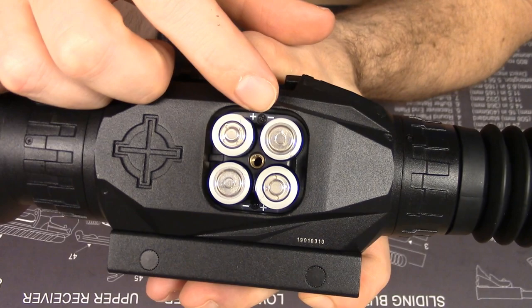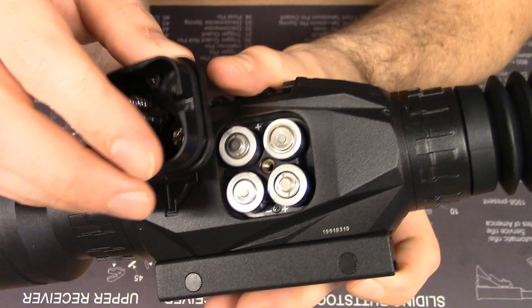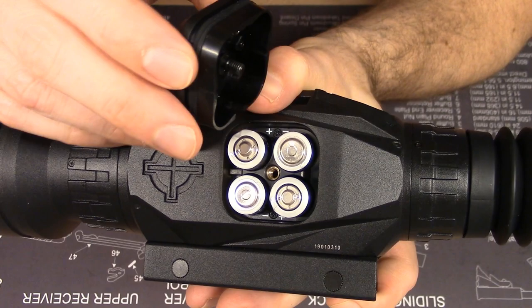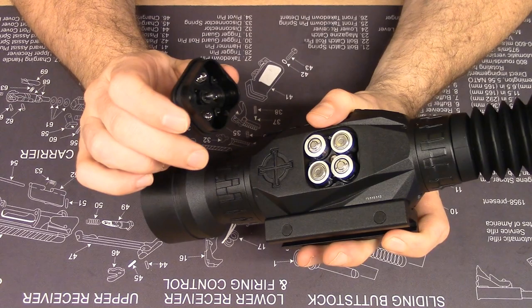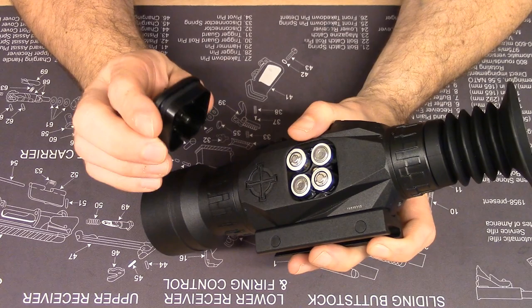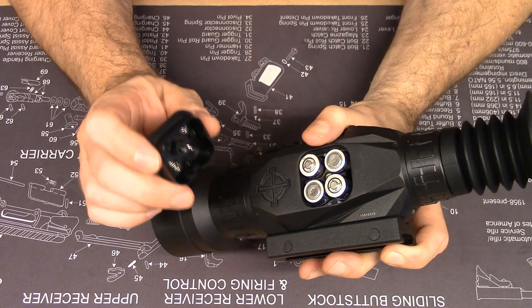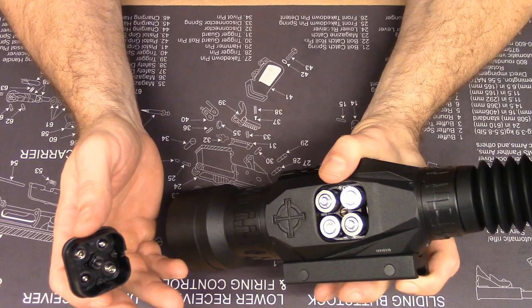The battery polarity is inscribed on the housing. The battery cover has a ribbed rubber gasket, which is a good feature, and it will most likely keep the battery compartment dry from brief rain, splashes, and other non-submersible water exposure. The unit is IP55 water-resistant. The first five means it's dust-protected but not dust-tight. The second five means the unit can withstand a 6.3mm diameter water jet from any direction with no harmful effects. So you can use it in the rain and you'll be good.